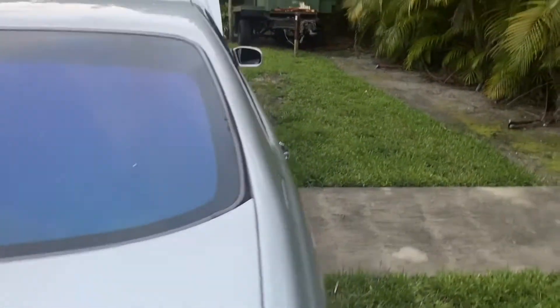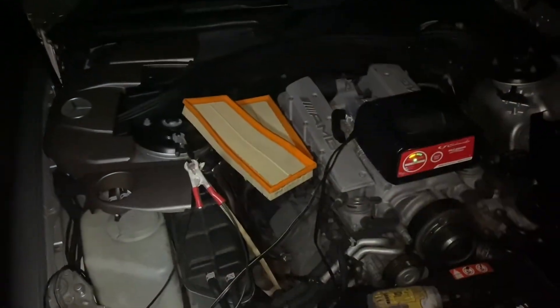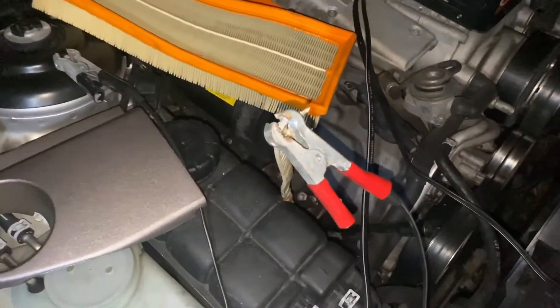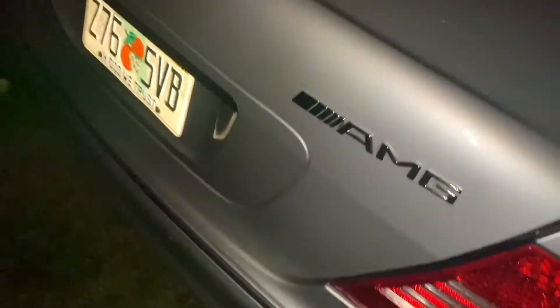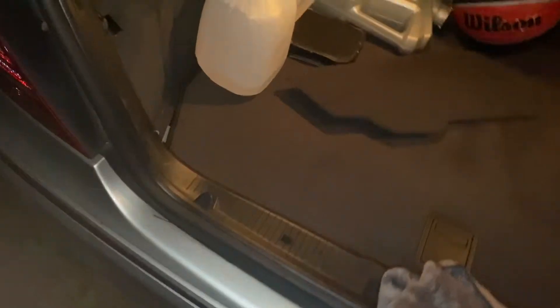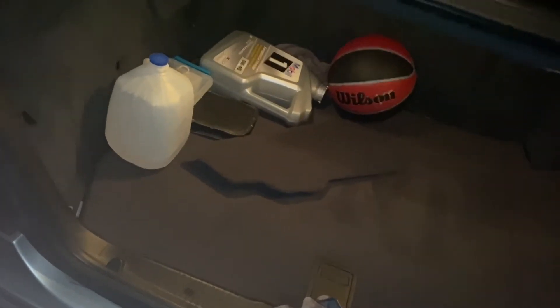Probably not enough amps in the system yet. As you can see, my little aluminum stick here has done a great job. We got power to the back, and I did get the trunk popped open — I stuck a rag there. What I'm going to do now is actually bring the charger back here and put it directly on the battery, because it's still weak. The automatic trunk wouldn't open, but it did click. So the battery was really dead.